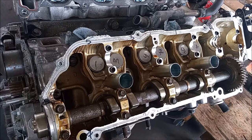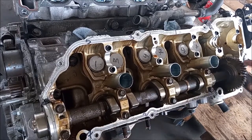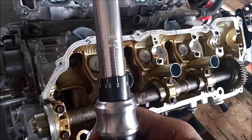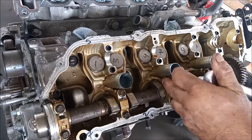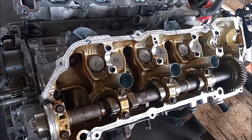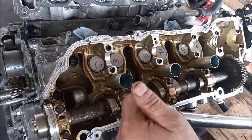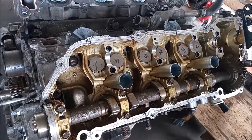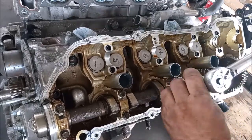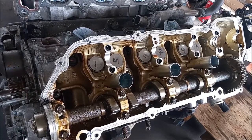The order for doing these with a torque wrench, starting from the center: one, two, three, four, five, six, seven, eight, nine, ten. The torque is 12 foot-pounds. After this pass I've just snugged them — I've not reached the specified torque yet, so let's take them a little further. They've all clicked. Now I'm going to make one more pass just to verify. This camshaft is all good.